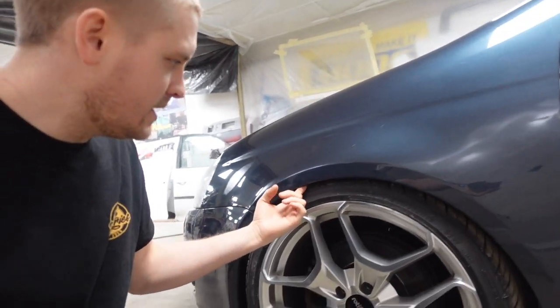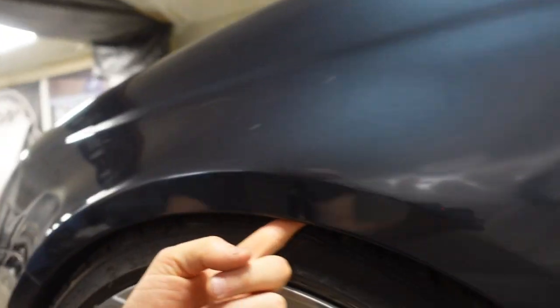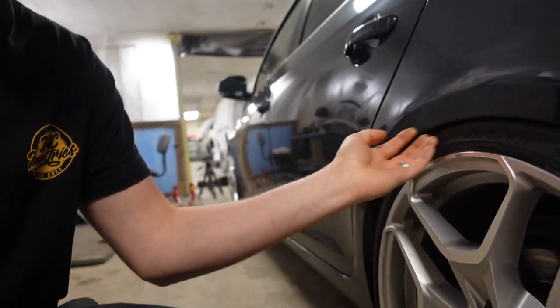It's pretty low. Just here is a screw which has dented the wing and that'll be what's rubbing. At the back I can't even get my hand in. We'll take the wheels off, get in and have a look, see what we can cut away to make it not rub.